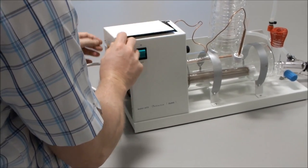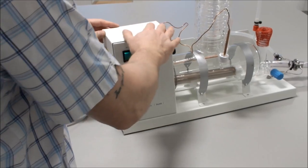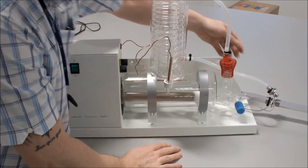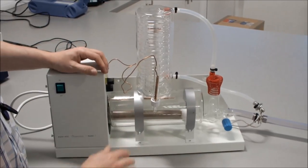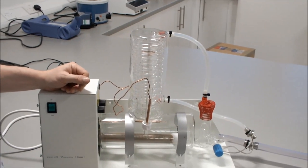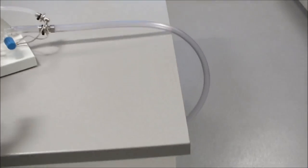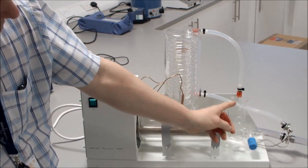Fit the end panel and tighten the four screws. With the unit connected, ensure you have good quality tubing held with hose clips for the cold water supply. Allow water to feed through with the stopcock closed, and check for any leaks. Turn the water supply off, then open the stopcock to drain the water via the drain and close it again. Don't forget to remove any covers, especially the red one from the funnel.